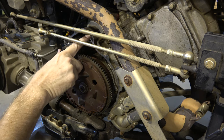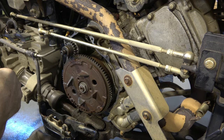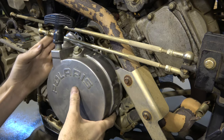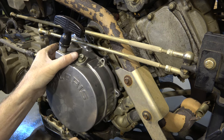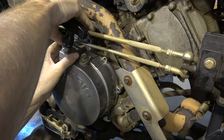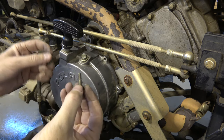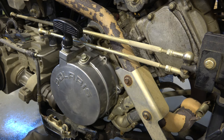There's the guide pin — make sure your gasket's good, mine's a little tweaked so straighten that out. You've got your linkage for shifting forward and reverse in there — get that out of the way. You've got to push down on your foot pedal and just kind of work it in. Double-check that gasket, then put all your screws back in — nine screws, one that's a longer oddball length that goes on the top left, and the rest go all the way around.